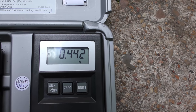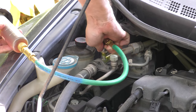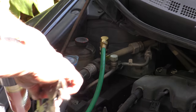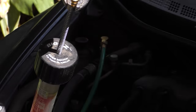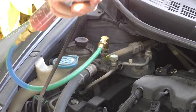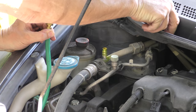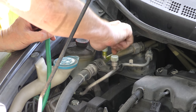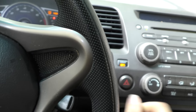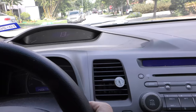There we go — now we'll add an ounce of AC oil. Hook it up the same way on the low side — this one just snaps on. The handle broke on this ages ago — they don't make things like they used to — so I put my little vice grip on and turn it until an ounce has gone in. Then we start it up, put it on max AC, roll up the window, and stick a thermometer in to see how cold it's going to get.